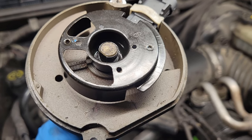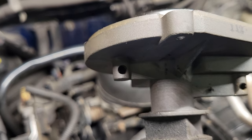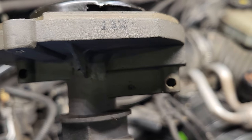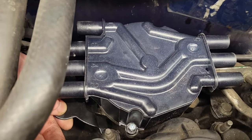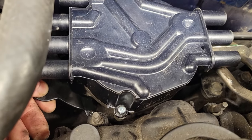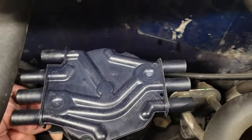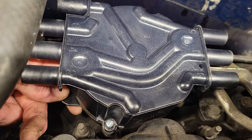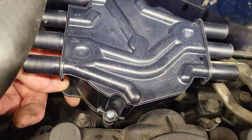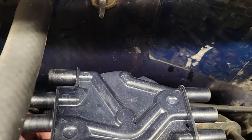A little tip: with these distributors, whenever you have the cap and rotor off, you'll notice round holes — those are vents. So if you get any moisture in your cap, the airflow from everything turning inside will help dry everything out. What I usually do is put the short screw in the front first, grab your support bracket, and reach down in there until you can line it up. You can feel it kind of butt up into place, then get a small screwdriver and start the front screw so the bracket is held while you start the back screw.